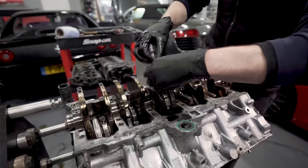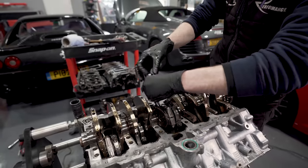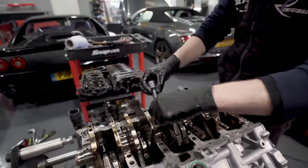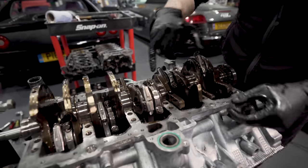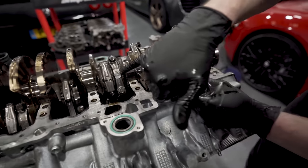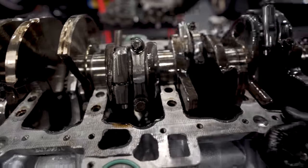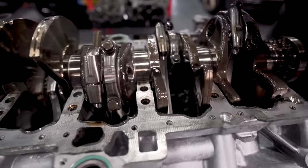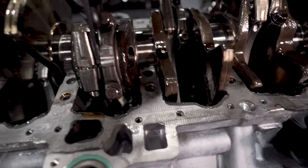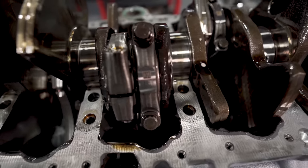So, two rod bolts, they're scrap. We don't reuse the rod bolts. Yep. Right. This rod bolts out. Okay, the rods, can you see in between? Can you see that flat machine pad? Can you see halfway down the pad on the left, down the slope, there is an arrow? It's not an arrow, it's an indent. Can you see it? Just there? Yep. That means 0.2 other rod.